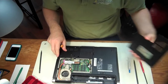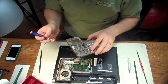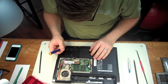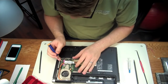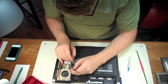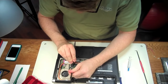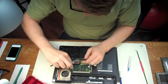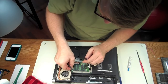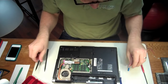That's not too hard. As you can see, these screws have a little lock washer that holds them in, so you don't have to worry about the screws falling out. The next step is we're going to unplug the fan because we're going to pull this whole apparatus out. Grab your spudger and pull straight up on the fan plug. It might be easier to tug on the actual cable — just be gentle. Don't yank hard because you could pull those wires out of the plug end.